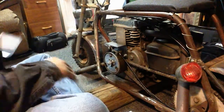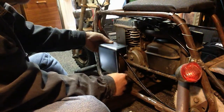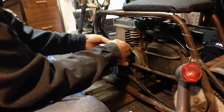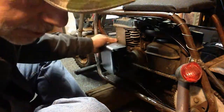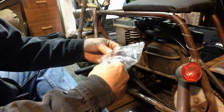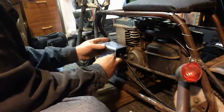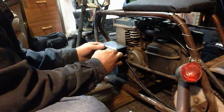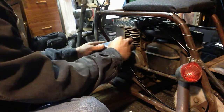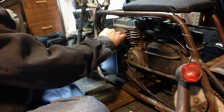Okay, so this will go on next, and I can bend it out a little bit, but it is, man, it's like you could put a matchbook cover through it probably. Other thing about this was the screws. The screws that they send you are just a metal tap screw. Meaning these aren't threaded. So you'll need a good torque on these. Probably best to use a drill if you can, like a cordless drill. Because they're not gonna start. They just drilled the holes, which is fine. I'd prefer a bolt and a nut, but this guarantees they're not gonna come out. That's a plus.